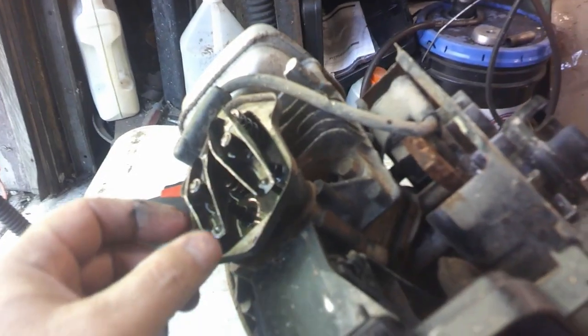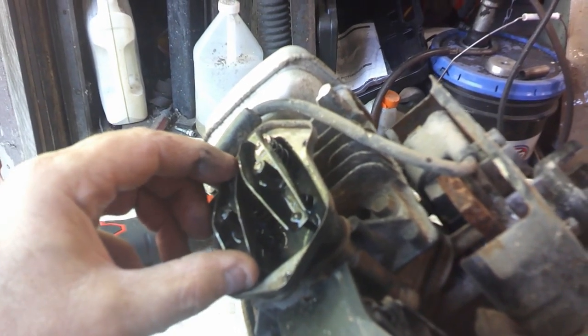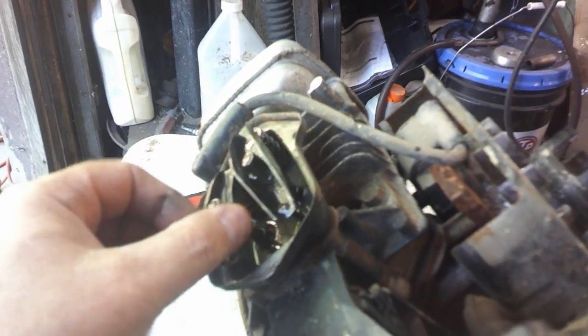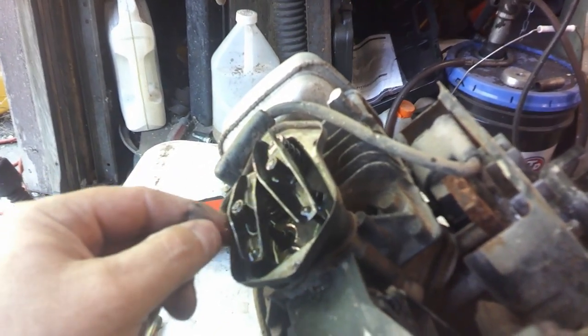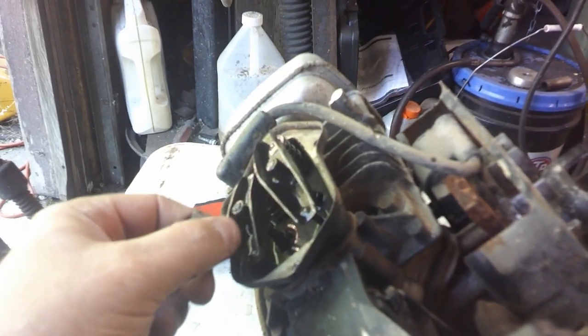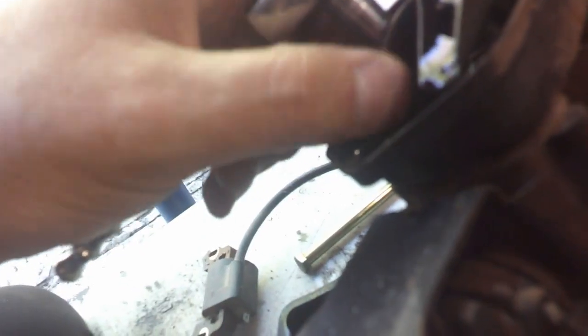So now if you do valves on these things, basically what you've got to do is check them to see if they're rocking back and forth. They've got just so much movement, but these things, you can tell they're just flimsy. I mean, this is literally almost tin can thickness, but these things really don't have to do much to them. What I do is, you can see how wobbly it is, and I just take that thing and tighten it up just like it is. I'm not going to mess with the feeler gauge. Just tighten it up.